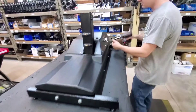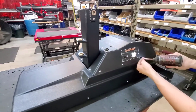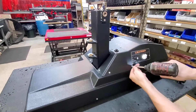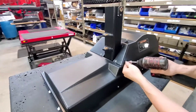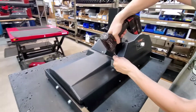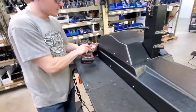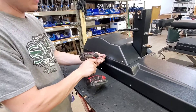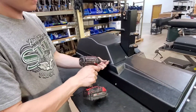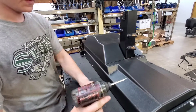The first thing you'll want to do is take off the top cover and check to see if your uplift starter has a nut on the top, because you'll want to start loosening that one before you start loosening the other three. Most of them won't have a nut at the top, but some of them might. It's just easier to do it this way.